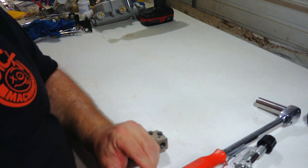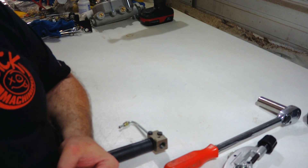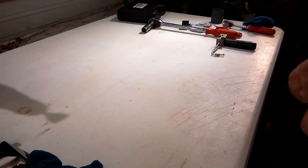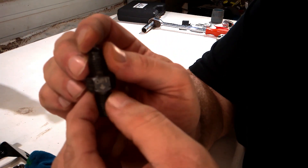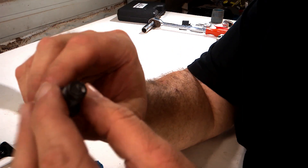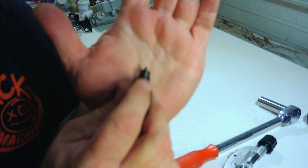They do give you some grease. Generally, everything I've always been taught is you never use anything on brake lines other than brake fluid — this looks like some kind of red grease — so be sure if you use this setup you use brake cleaner and blow your lines out with air before you install them so there are no contaminants. The tool is marked: Op1 is going to be the side that creates the bubble flare — the back side and top will both be beveled the same. Then you flip it over and Op2 comes to a point, and that point creates the inverted flare for the mating surface with the fitting itself — therefore double flare.